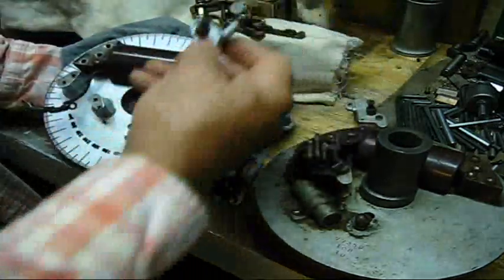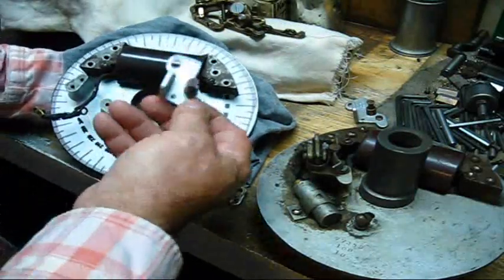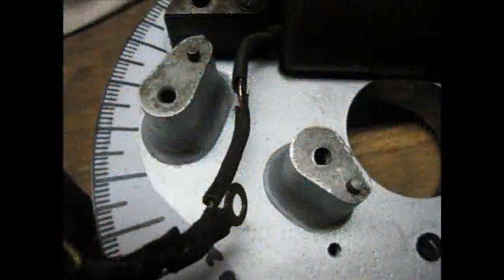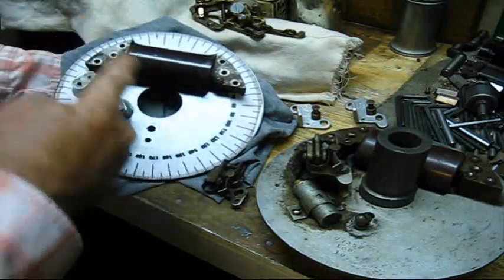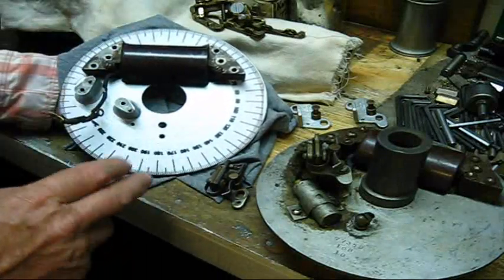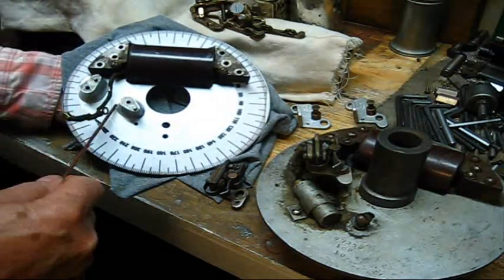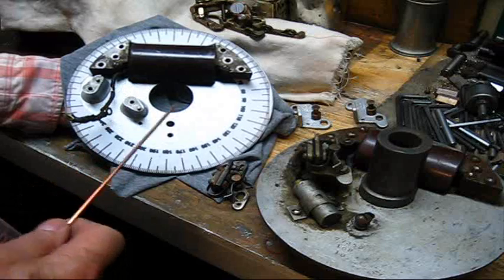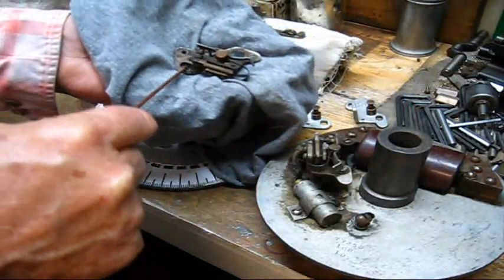The one before that is this type. You will encounter more of this type — fixed point blades, point bracket. And it won't fit on there either because when you try to get it on there, the pins are in the way. You can use this backing plate because there are a couple of things on here which are the same on all of them: the center line and the position of these two drilled holes right here. That is exactly the same no matter what shape the bosses are. No matter what shape that is, that hole will be in exactly the same position. And on these points right here, the hole down here is in the exact position too.